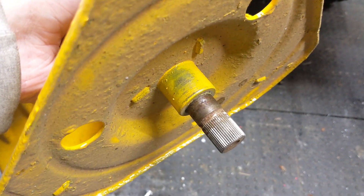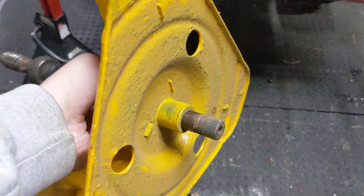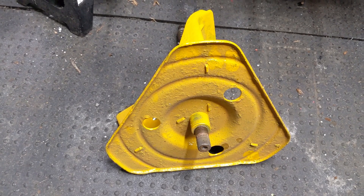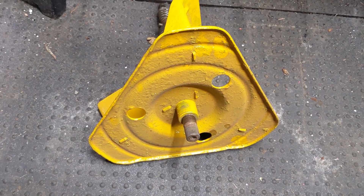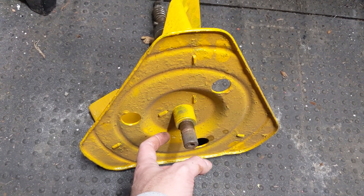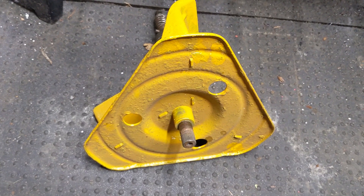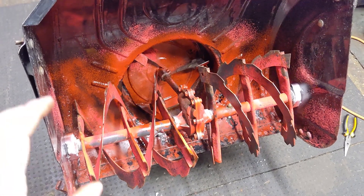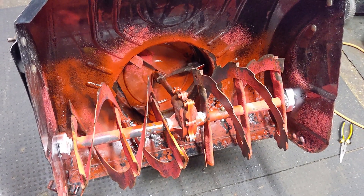Removing the auger assembly from the housing can be quite difficult because there's a main auger bearing that attaches to the back of the shaft as well as the pulley. Since snowblowers run in winter, snow is wet and parts corrode onto one another due to lack of lubrication. The pulley can seize to the shaft, requiring special tools like a flywheel puller. The bearing's inner race can also seize onto the impeller shaft — sometimes we've had to cut it off using a zip disc on a grinder or use heat from a torch. Once the auger assembly is removed, the disassembly is more straightforward.